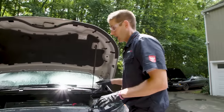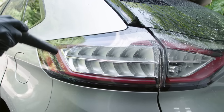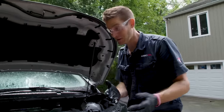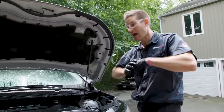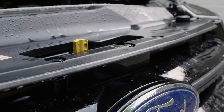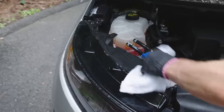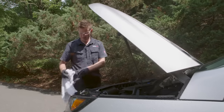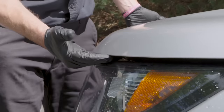Take your hose and rinse in a fan motion — not a narrow stream. Go in nice and wide and just kind of rinse it down. Keep it simple, don't go too nuts. Then grab your terry towels and dry the engine off. If you have compressed air or a master blaster, that's great too, but they didn't make the bare minimum list. The engine cleaning should take no more than four to five minutes — you're simply maintaining the engine's appearance. Finally, close the hood until the first latch catches but not all the way — you'll need to get back under the hood at the end of the wash.